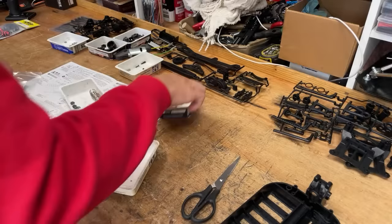All right, so now... I don't really know what the full bleeding procedure is. They're all a bit different. Right. Cycle shock up and down, we've done that. Install bladder slowly at an angle. Then put lid on, right. So, we get the bladder, which is in there. Here's a bit where it gets messy. You should really take the springs off. I can't be bothered. The bladder on top is where it leaks out a little bit. And then it says to put on the lid.